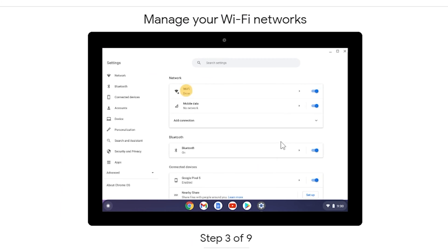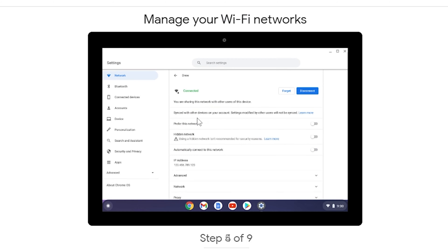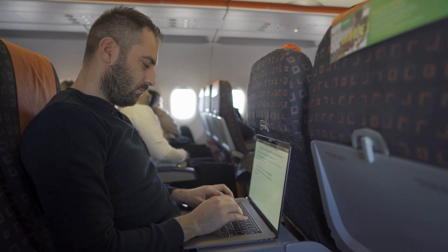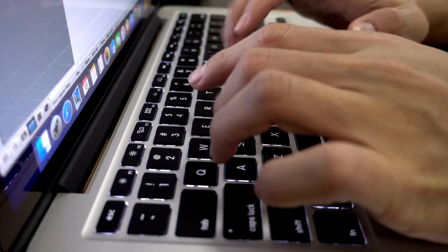If those basics don't solve your problem, try forgetting and reconnecting to the network on your Chromebook. If you've recently had updates applied to a router or you're connecting to a new network for the first time, it may be an authentication issue with your device. This also applies when connecting to hotel Wi-Fi or someone else's Wi-Fi where the device may not recognize that there is internet. A little trick for plane or hotel networks: if those splash sign-in pages don't appear, open a browser and type in logout.com — that one word will typically force a refresh and make that page pop up again, allowing you to sign in to the network as usual.